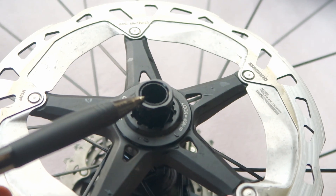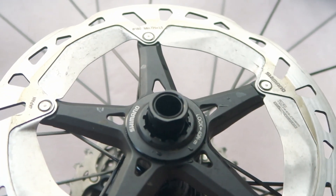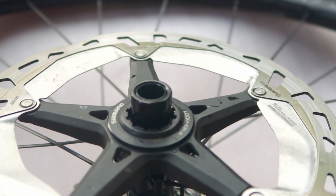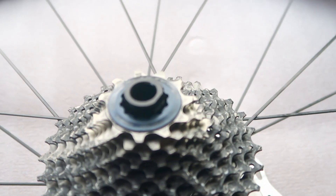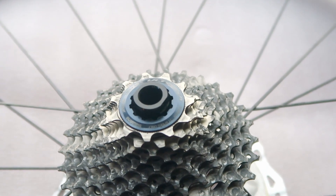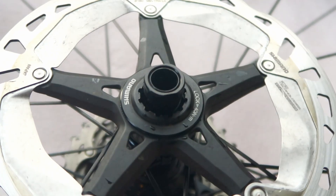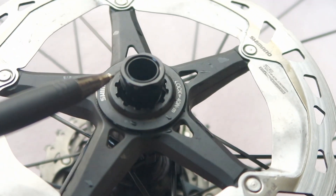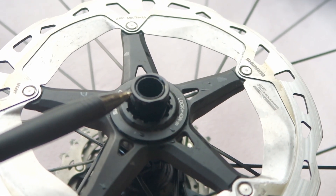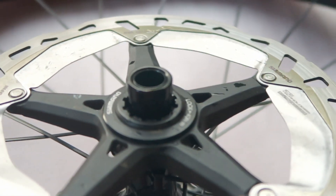Going back to the end cap thing on the rear hub: the end cap is slightly weird. The axle is very long and threaded, coming a long way through the end cap but not protruding - it's about 0.5mm shy. The end cap surface area where it gets clamped into the dropout is very, very small compared to the other side where it's much bigger. I hope that's not going to bite into the dropout - it's putting the same clamping force over a smaller area, so pressure goes up significantly at 12 Newton meters. It would be nice to see a much bigger face on that end cap where it goes into the dropout.